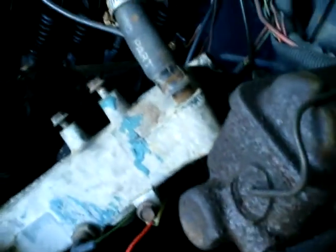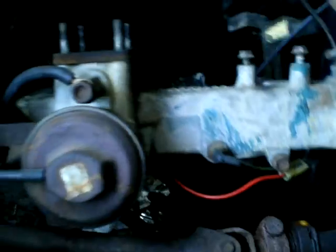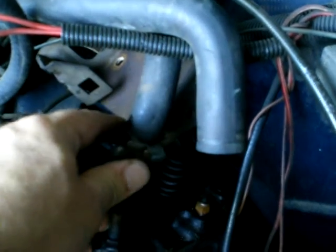I don't know if any of you guys working on cars ever had that. Simple matter — you just loosen the pliers so that when they're closed they're at their loosest spot, and just break it loose. The air is loosening around and all I can do is just pull it off. It should pull right off. I've got to use two hands so I've got to shut the camera. I snugged the clamp up on the hose so it won't get lost and I just pushed the hose up there out of the way. As you can see, I made a mess anyway, but I got these hoses off.